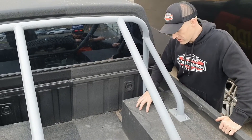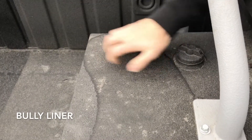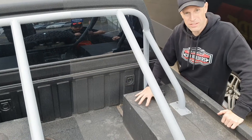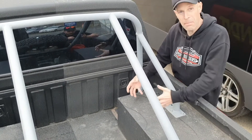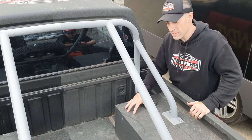You can see the fuel on this side — this is the Bully — has evaporated. I can scratch that with my fingers and it's still dry, still solid, it hasn't separated. The concern is whether it's going to bubble up like if you put paint stripper on it, and the answer is no. So I would say this is fuel resistant.